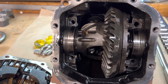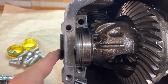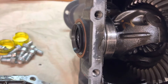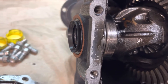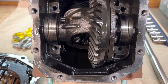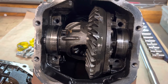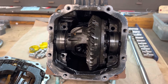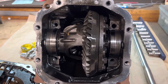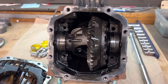All these shims are going to be kind of like on one side of this rear end versus the other, and what that will do is cause this axle to protrude out of this case enough that it will not seal properly to the axle seal. There has to be a fix for that, and we're going to show you that in later segments — how we resolve the issue of an axle seal leak when changing from a 4.10 to a 3.63 gear ratio in this particular NC Miata differential. Stay tuned.